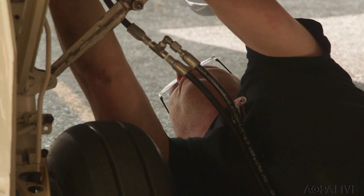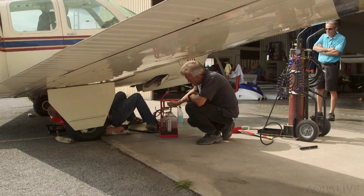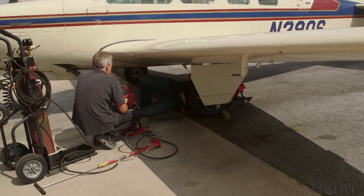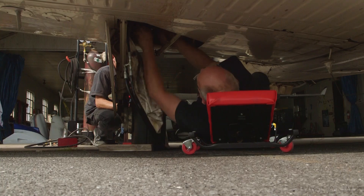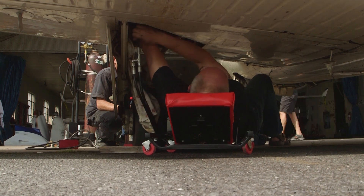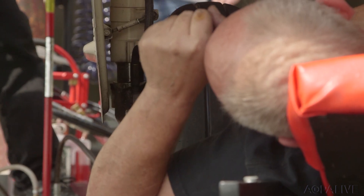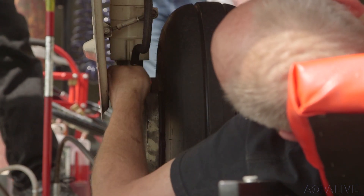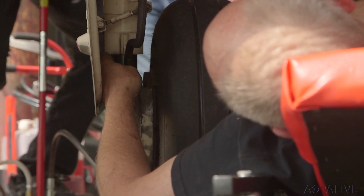Here's what you can do to keep your strut in good condition between service periods. Struts are dirty — dirt gets up under those seals and contaminates them. It dries the seal out, makes the seal actually shrink and let air by, and sometimes fluid. A pilot can keep an eye on the struts — keeping them clean is the main thing. Use 5606 hydraulic fluid; do not use automotive fluid. With a damp towel, wipe them off — that cleans the strut and also puts a little lubrication on the strut tube.